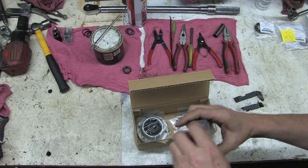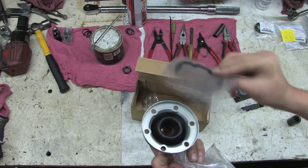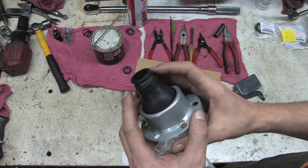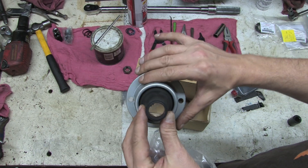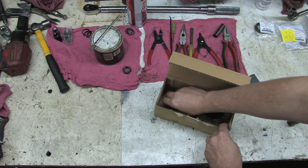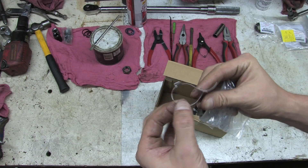The boot kit comes with a 60 gram packet of grease, which the service manual is very specific about — they insist that you do not over-grease it. It's measured to ensure you don't overflow the joint. The joint comes with new rubber gaskets for the cup and the boot. There's also something you need to pay attention to on the boot — they've marked it in green to help you notice it. There's an arrow molded above the groove where you're supposed to align the fat part of the band clamp. It's situated out of phase with the air breather port on the inside of the boot so that clamping it down doesn't block it. Grease will also block it, so be careful here. The included clamp is a special type that won't throw off the balance of the drive shaft like a worm gear clamp would. You don't need any special tools — a pair of needle nose pliers works just fine.